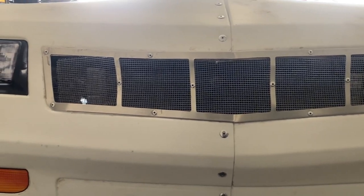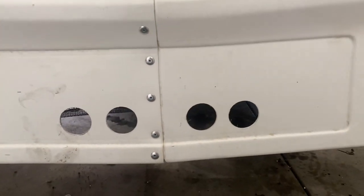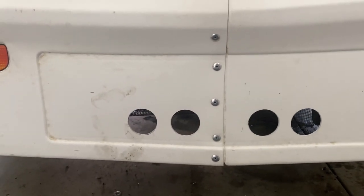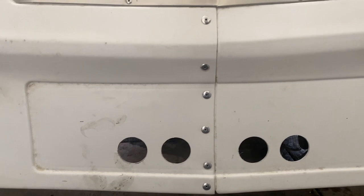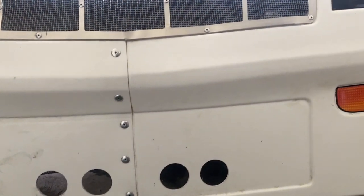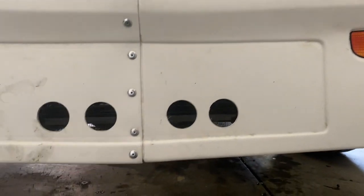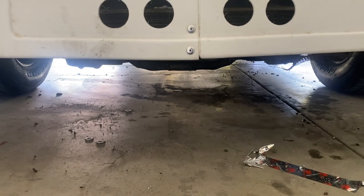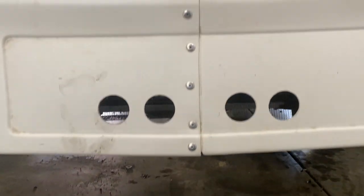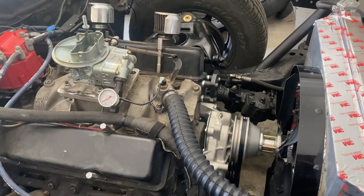You can see we have a screen here with direct airflow to the radiator and a couple holes down on the bottom. The trade-off is that the more you open everything up, the more mud gets clogged on your radiator. So there's a compromise — find just enough holes to get the airflow needed to cool it down. You can also run a dam underneath the radiator that scoops up a lot of air into it, which helps quite a bit.